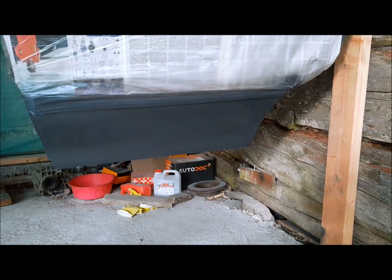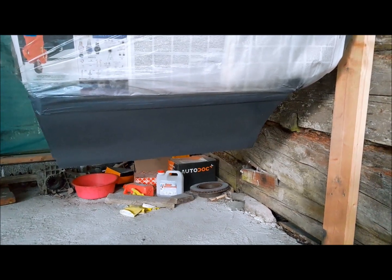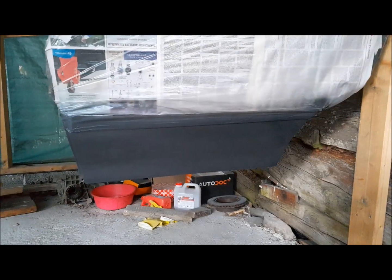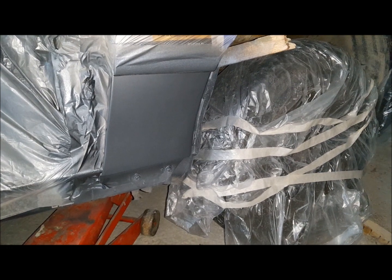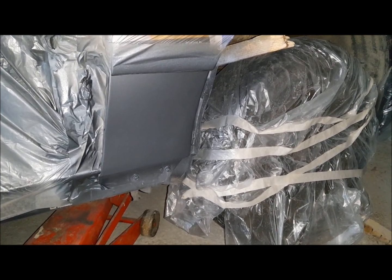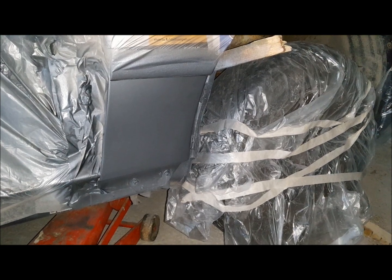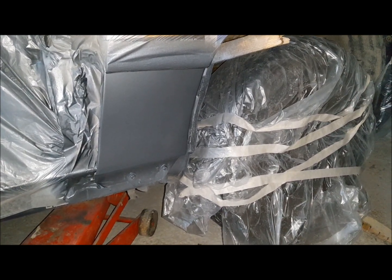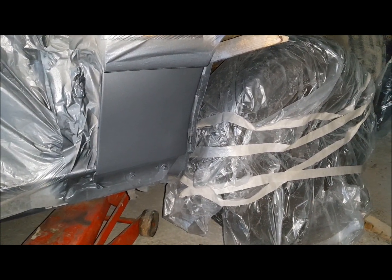I finally got all three doors painted and also the front wing. I spread three layers of water base and four layers of clear coat and I'm pretty happy with the ending result — it shines nicely and the color looks good. I always use the same kind of method while spraying this kind of paint. The first layer of water base I spray kind of partly covering, then a wet layer, and the last layer is spread from further away. When it comes to clear coat, the first layer is dry and the rest are wet layers to give maximum shine and gloss without getting runs.